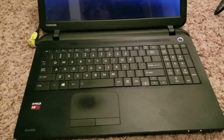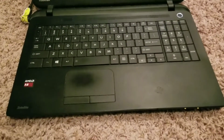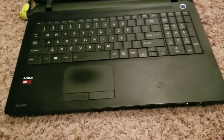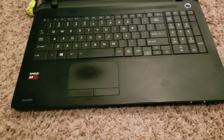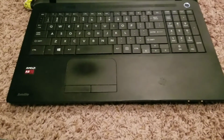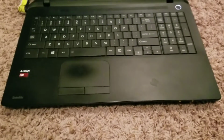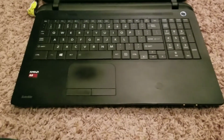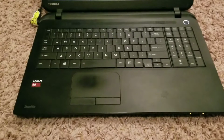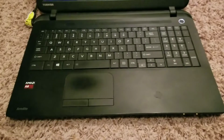If you go into the BIOS, normally it asks for the passwords, which I don't have. Since I don't have the password, I can't enter the BIOS. But if you clear the CMOS battery settings and wait for the time and date is incorrect message, then go in and change it that way, it gives you unlimited access to the BIOS because it auto-fills in the master password. Then there, you can actually turn off the master password without inserting the password. I know, that's great. Security.